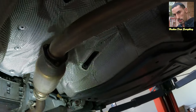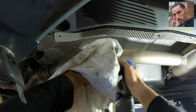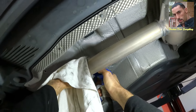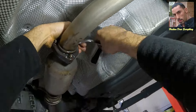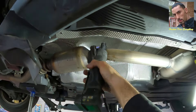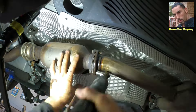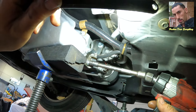The exhaust needs four bolts removed — one holding the exhaust and three bolts. Don't forget to put anti-rust on the bolts and be careful, because even with anti-rust, the bolts can break when you loosen them. If they break, you'll need to go to a shop to fix them — they are not hard to fix, but be careful.